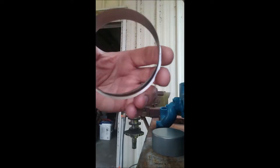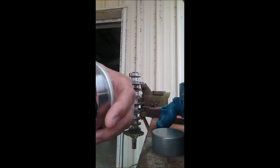It probably won't stay on when I put it on, but I'm gonna put a little seal on the inside of the ring. I'll rub that around all the way on the inside. I don't think it'll hurt any — put it in there. I kind of believe it may actually help, but it's probably gonna be wiped off anyway. Let's see if you can see the crankshaft from here.